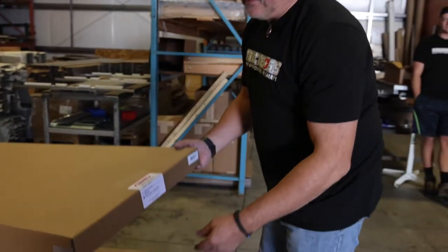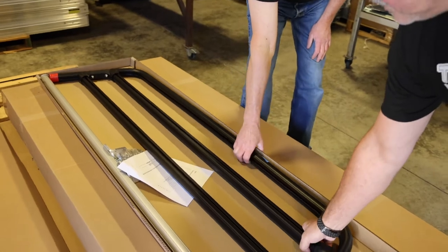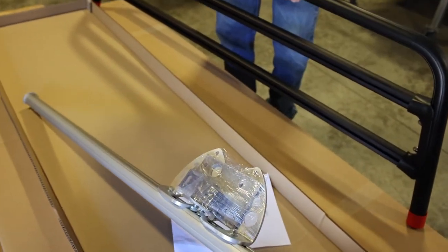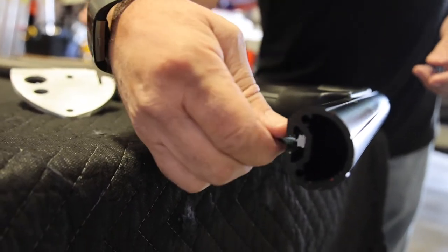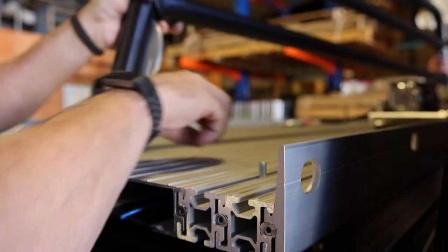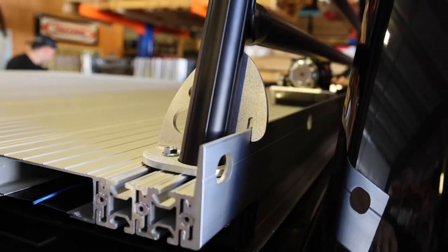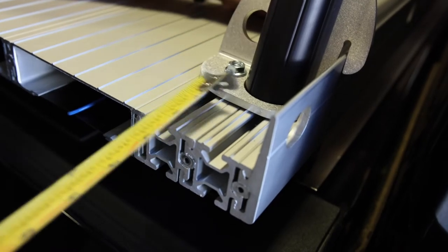After all the panels are on and we have the winch mounted, we can go ahead and put our cab guard on. Cab guard is box seven — it contains the cab guard and ramp bar. You have your cab guard with all of the hardware pieces on the ramp bar, so unbolt those as those are the hardware you need to mount it. To install the cab guard, put the cab guard brackets on and slide the bolts in. These come up, you have a bolt and a nut, and it slides to the second rail back, putting the notch over the edge and in the bolt. With a partner, measure two inches from the edge of the panels — that will put you right in the center — and tighten down.